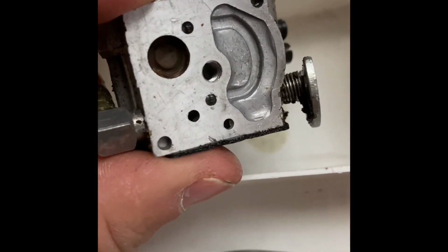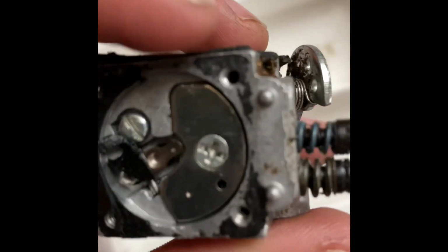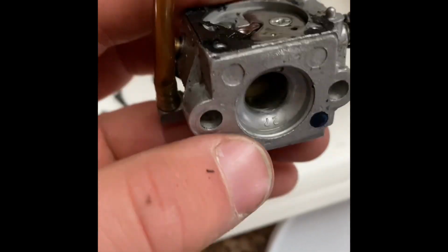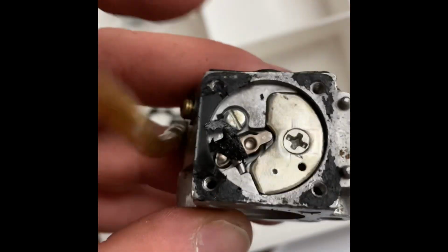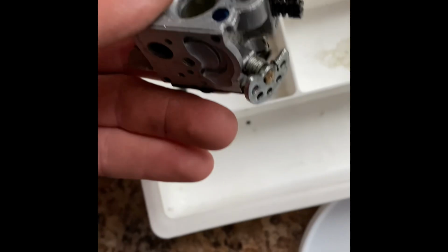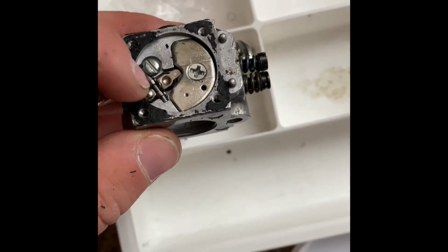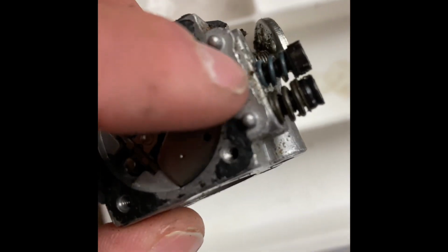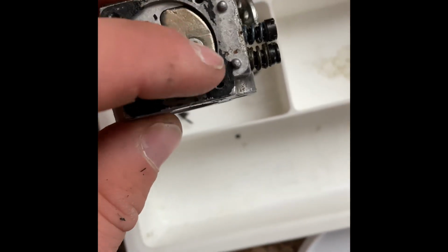Pretty cool, huh? Well, if you're wondering how it's going, not well. This gasket just kind of decided it wanted to stay part of the carburetor. But lucky for us, I'm pretty stubborn too, so we're gonna get it off. But here's where patience and a little extra time will do you good. Just grab it, be very, very careful, because this is very soft metal. If you gouge it, you'll likely end up with a leak, and you don't want that. So we're gonna be very cautious.